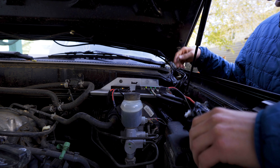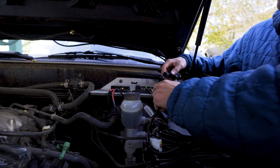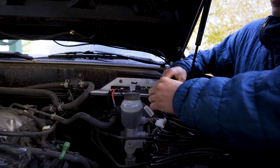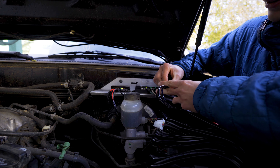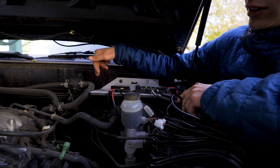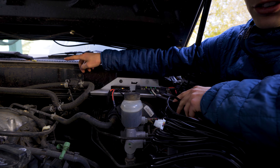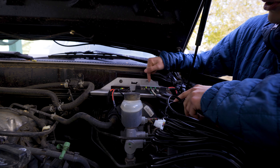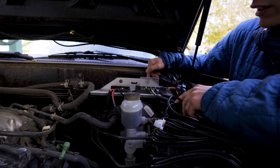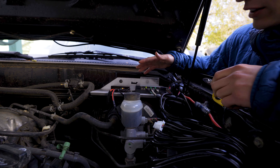On the other side, the plan is really similar — we're going to use the stock wiring harness from the Auxbeam just to add in these connectors. Then we're going to cut those two wires, join them together, and run them underneath the fuse box tray. Those two wires will connect with the other two wires from the ditch lights on the passenger side. We'll solder those together, and then coming to the fuse box we will only have two wires — one positive and one negative. I'll show you the whole process and explain it more as we put it together.